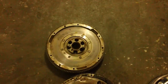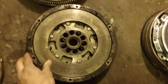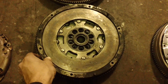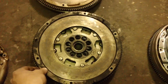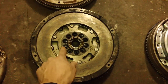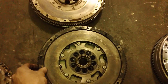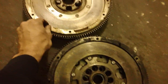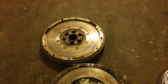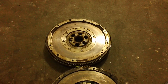You're saying, why can't you just surface this flywheel? Because of the way that there's springs in here, they can't put this in a lathe — it would bounce around when you're trying to machine it. There are a couple places out there that have a fixture or something that goes through these holes so that they can machine it. But look at this — this one's broken. So you do that, you put it back in, and it seizes up or starts making noise, and you're pretty much out of luck and you get to pay the labor again.